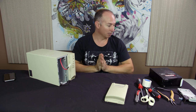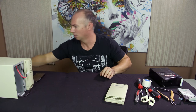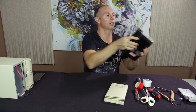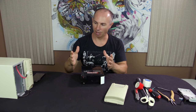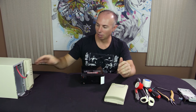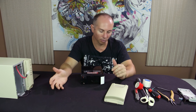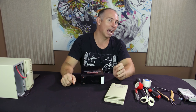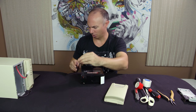So let's begin doing this. I got some double-sided tape, I have some tools. The first thing I want to do is recreate the battery connections and the setup that was in there. When you take it out, I take photos so that when I reconnect it all up, the connections are identical. It should be pretty straightforward, but it's always a good idea to take photos before you disconnect things so you can see how they were connected. Because you've got this little wire here, that's the only thing that connects from one side to the other side somehow.